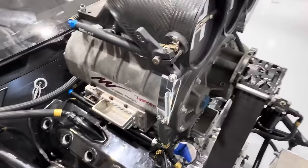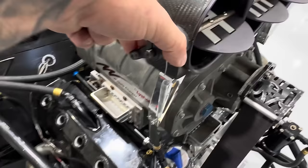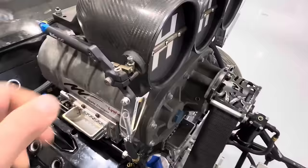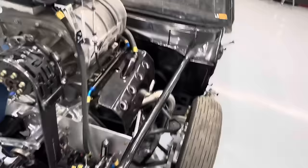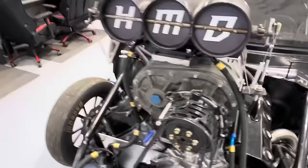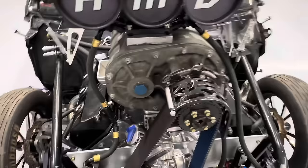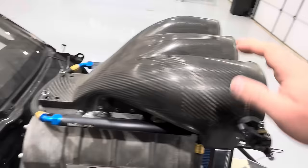There's still guys out there that want carburetors but want Holley to do all the data logging and ignition control. So this will have a two-inch stroke shock travel sensor that changes voltage when you go to wide open throttle. We'll go over setting that up and how to use it. The blower — the screw blower like this — may look ancient, but it's actually a really good blower. This is a magnesium case, that's why they look a little rough.